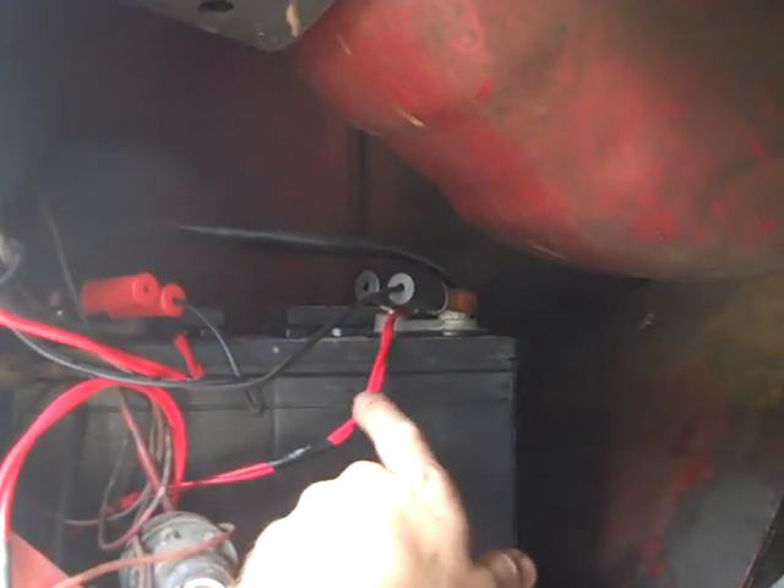I found out the wires up inside there were messed up, made my new wire, and now I have that. There's another grounding spot here; there are my alligator clamps, and the wires that go to the other battery to charge it while I'm driving. The lights in the back all seem secure and I don't have any problems back there, but the ones here wiggle and pull — something I could probably replace to save myself a lot of trouble. Another thing was where the guy had hog-pinned everything — I ended up just finding that the original grounding spot where the screw goes in was broken off, so I just use an alligator clamp to clamp it where it's supposed to ground.